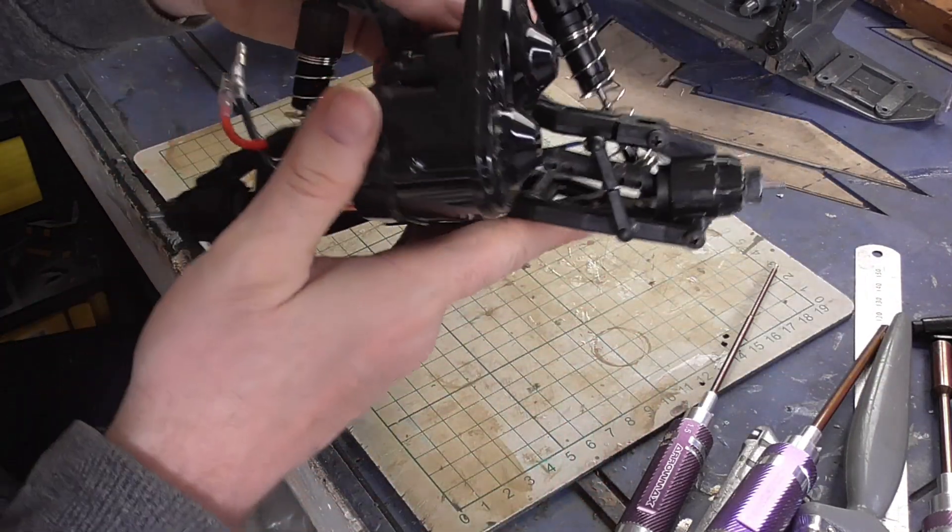Make sure this is done up and then you just have to swing the ball end upwards and it should be on. There's one and there's the other one — bit fiddly. Then all you've got to do is put the single pin we took out and screw it back into place. We've done it correct. Then we'll flip it and there you can see the torsion bars underneath, and it's as simple as that.